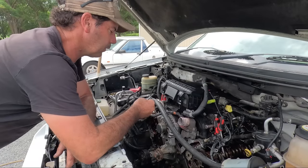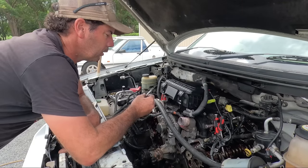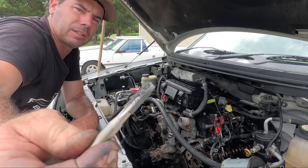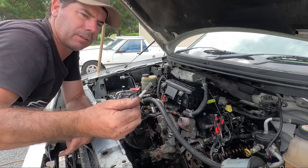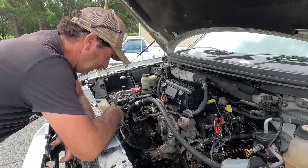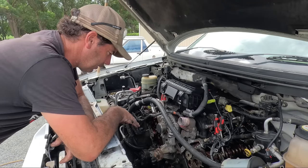That was one thing else I forgot to tell you. I put a dab of grease on the bit, and if you can see why there, it's collected basically every bit of shaving on the tap rather than in the sump. In this case, I've got a rag sitting in the bottom of the sump.